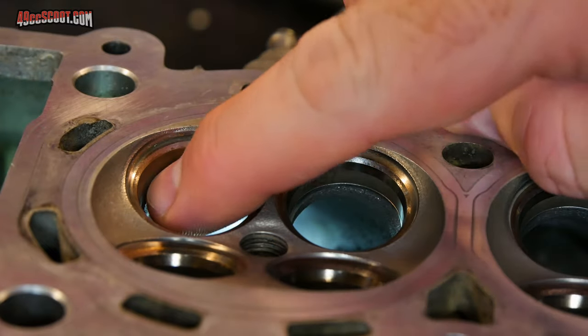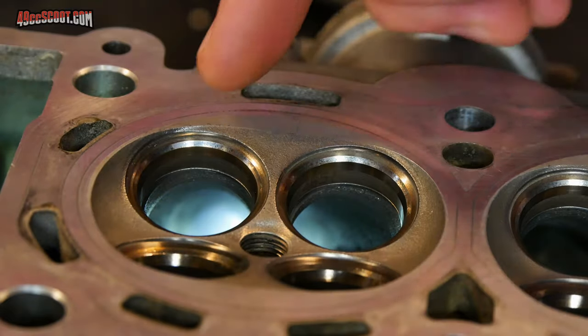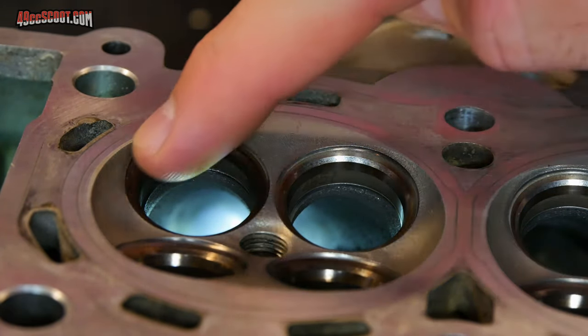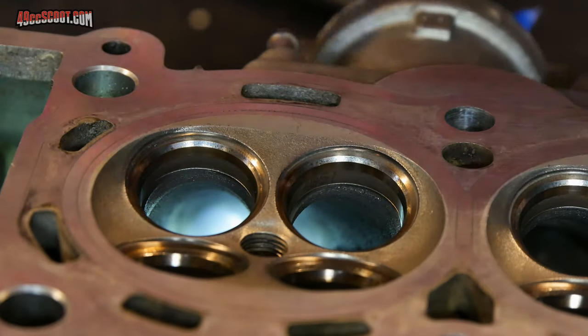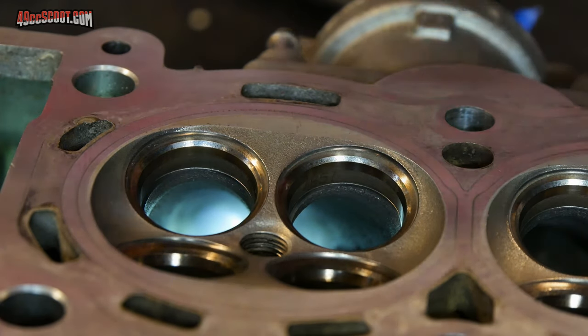If you've got very thin valve seats, so you don't have all that extra area there, or maybe even if yours are this way, but you just want to push the porting a little further, then what most people will do is mark this area of the seat, all the top area, using Dykem or layout fluid, whatever you want to call it, or I just use a Sharpie. And I'm going to go ahead and show you this process in case it's of use to you.